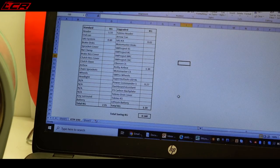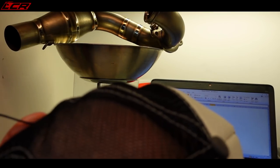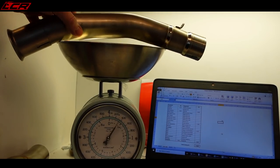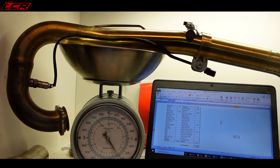Let's get the header stuff in there and measure it again. We're going to use the kitchen scales, not the bathroom scales. One Tecmo front header piece: 720 grams for the front titanium piece. The rear section weighs 440 grams. That comes to 1 kilo 160 grams. Standard header comes to just over 2.6 kilos, including the lambda sensor.